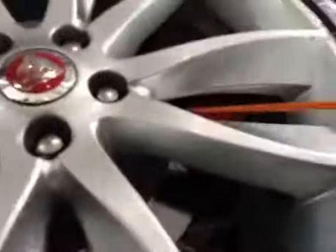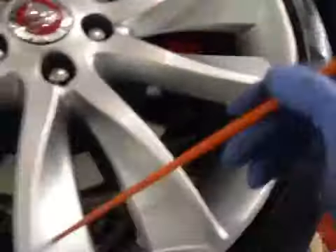All the same on the driver's side — all suspension is looking okay. Driver's rear tire is in good condition. Rear disc is in okay condition. Your rear brake pads on the driver's side are also about 6mm, so pads are in amber, disc is green, and tires are in green on the health check.